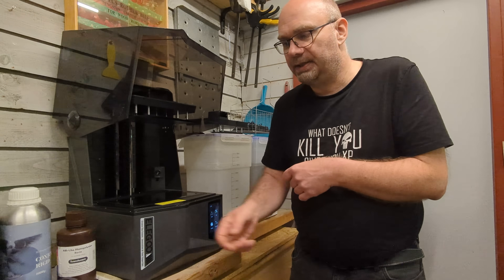There's a new software update for this printer and I will show you how it works. The first version was not complete because it didn't tell you what you actually had to do. And it all comes down to these four screws. Heads up: the first time I tried it, it was a pain, because when you loosen these screws the build plate goes down, and when you tighten them it goes up. So before you begin, just turn these 180 degrees — half a turn on each screw — and it will make your life a lot easier.